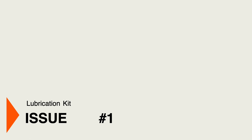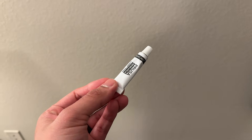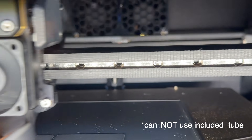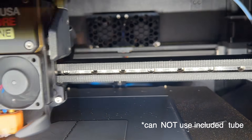So in my 6 months of using this printer almost every single day, I have 5 issues with Prusa and Prusa products. The first issue is the lubrication issue. When you buy the printer, they give you a lubrication tube you can use to lubricate the rails where the print bed moves up and down. But the rail where the print head moves left to right requires a special lubrication kit — not the one that comes in the kit. Apparently those are two separate ones and you cannot interchangeably use them.